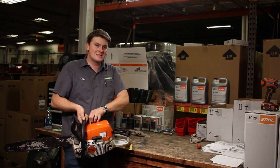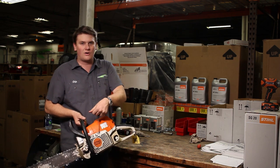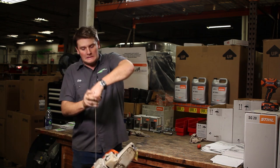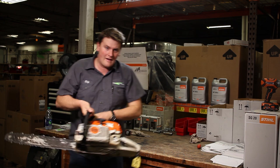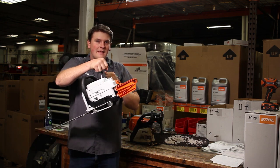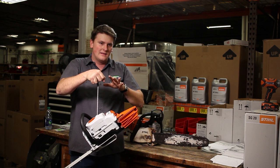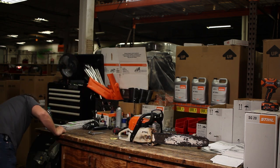If your decomp valve is pressed, it'll still fall. But if this isn't pressed and it's a medium-sized saw, if you were to let go of this, it should stay up. Okay, see that? It fell. I have another saw here — brand new saw, compression's fine. Same test. That's what it should look like, y'all. It should slowly fall. It's slowly going. The first saw fell much faster. It has low compression.